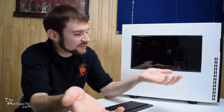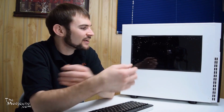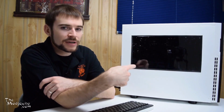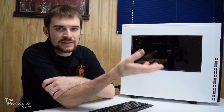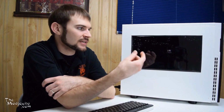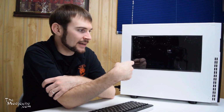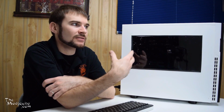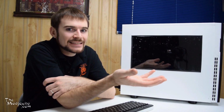Now, that's not to say that theirs won't be better. I mean, my system was probably better, my water cooling's better, my cable management's probably better, but that's just iBuyPower. They had a while to work on this. They had it at, I think, Computex 2016, and then again at CES 2017, and it's still not in retail. So I'm sure they got a more clear panel. They probably have a better way of mounting it because they have access to manufacturing. They went to a manufacturer and said, hey, can we get a transparent LCD that's more clear than just a standard LCD? Because this one has a polarizing filter on the inside that you need in order for it to be an LCD monitor. The problem is it makes everything a little bit fuzzy and a little bit darker, which I couldn't really do a whole lot about.